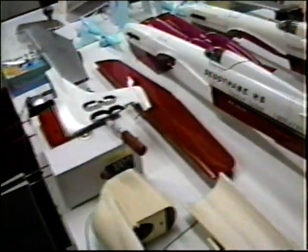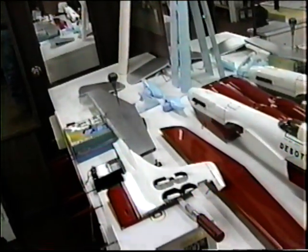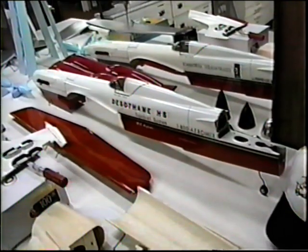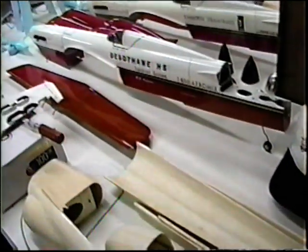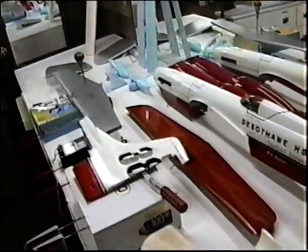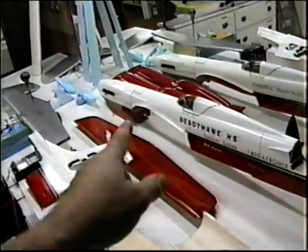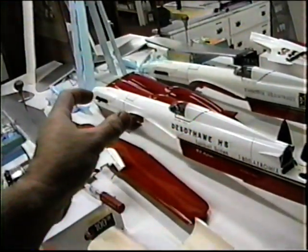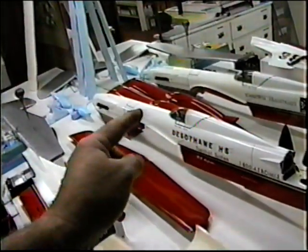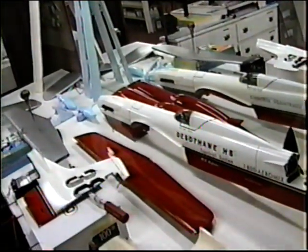The reason I've gone with this type of take-apart system is because we've built two planes, we've built three so far, with this similar system, and it's been, for all purposes, dead reliable. So I didn't want to get too cute here and try to invent some kind of new system with different brakes and joints. Now, the other thing that's different is on a plane like this with a motor in the front, I realize I've done something by adding the extra two bolts there that's really, I hope, going to firm that up.